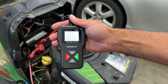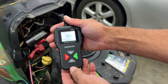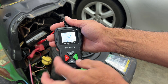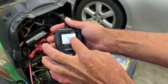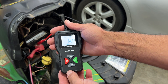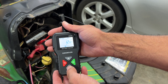It's just down about 100 amps, which says normal, but this battery is on its way out — I knew it when I bought the tractor. The status of health is 42, which is not 100% — it's on its way out. Status of charge shows fully charged because I charged it for two hours. Internal resistance is 0.013 ohms, which is really low — that says it's normal, OK. And 12.6 volts, which is pretty close to what I measured.